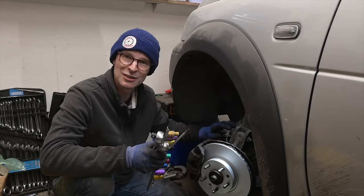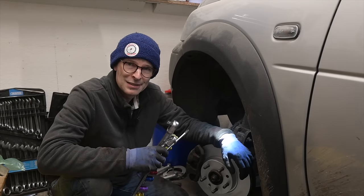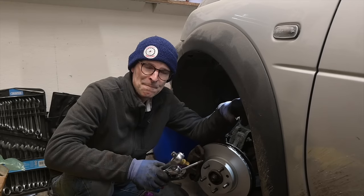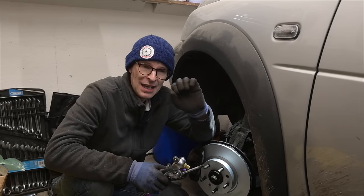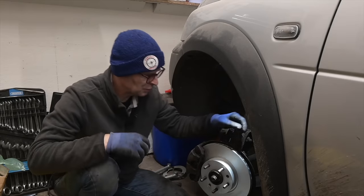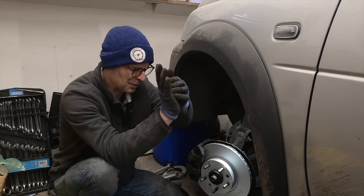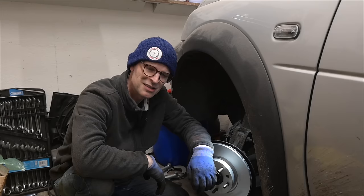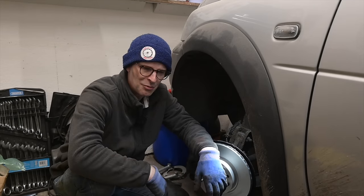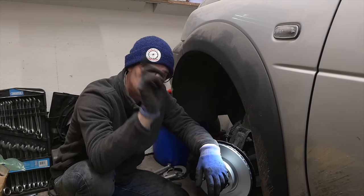The flexis and hard lines on this side look decent as well. So I've got a little bit of shopping to do to put this back together in terms of the front brakes, and a lot of shopping in terms of the back brakes. I'm tempted to change the rear wheel cylinder on this side of the back as well, just as a precaution. Because having had one explode on that side, the weak point may be the cylinder on this side too. I'm not quite sure where the dodginess in that rear wheel cylinder on the driver's side is coming from — it fits up okay but as you tighten up it seems to go on the wonk and pulls the bleed nipple through the hole in the back plate. I think corrosion may be an issue, so a new back plate, new shoes, new cylinder — preventative maintenance.